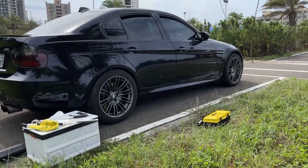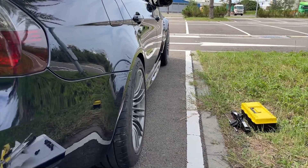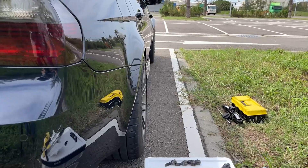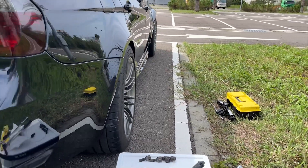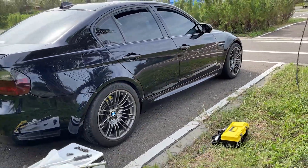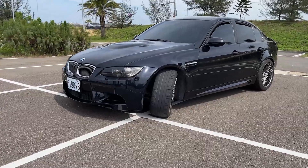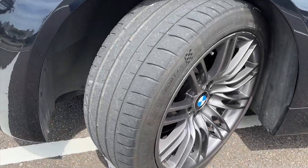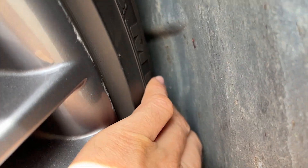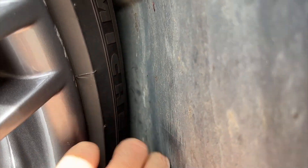All right, that's all four wheels done. Now I'm convinced that photos on the internet are just for reference — we really need to see the fitment with our own eyes to find the perfect match. There's one important item we have to check before hitting the road: will the tires rub the inner wheel arches or not? When I fully turned the front wheels to one side, there's barely space for my index finger between the tire and the inner wheel arch — perhaps less than 5mm gap. Same situation for the other side.